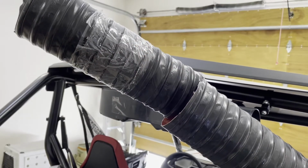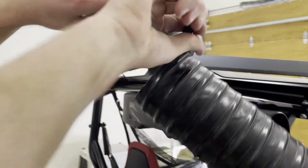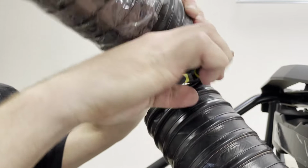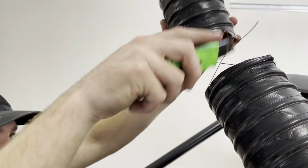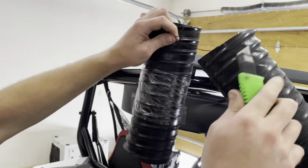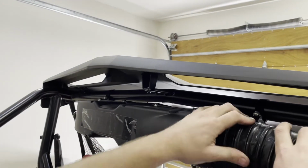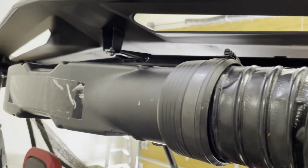And then once we've gotten to the wire, I'm going to grab a pair of cutters and come in here and cut the wire itself. There we go. Use my utility knife on the rest of it. We're going to put the cuff over this end now and slide the whole assembly onto the separator. And I'm pretty happy with my cut length there. So I'll get a screwdriver and tighten down that hose clamp.